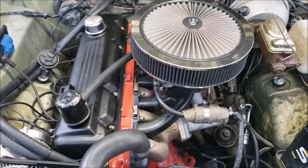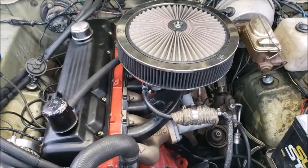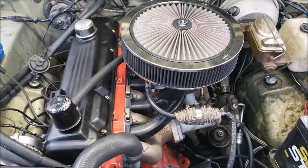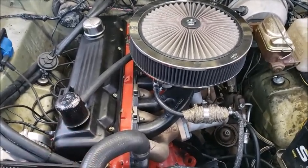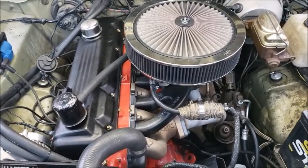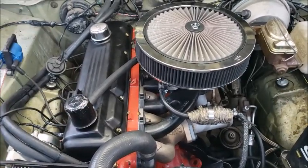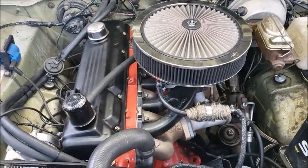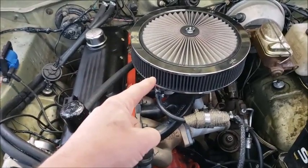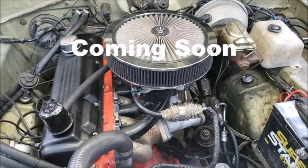This is how you adjust it if you're going to be running a hydraulic profile with a solid lifter. On this engine, for this setup, it was four and six thou - and it's nice and quiet now. You guys also got to see the oiling system and how it works. Next time we'll be getting into the carburetor, but that's for the next video. Alright, you guys take it easy.